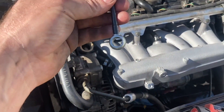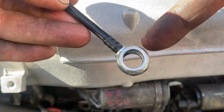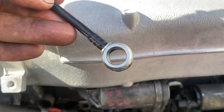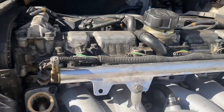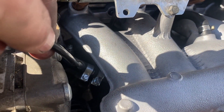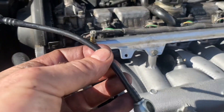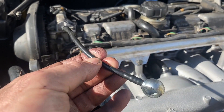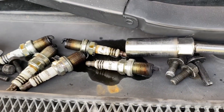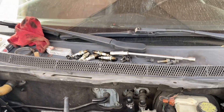Now PCV — a modification Volvo Yoda told me to do. This usually has a big U-shape on it going around the outside, kind of wraps around — it's a water line, and I assume it's for a different climate than we have. Separating it just gives you more room to take the inlet manifold off, so that's now separate. It's just a vacuum circuit now.